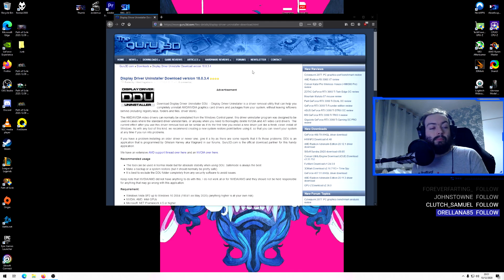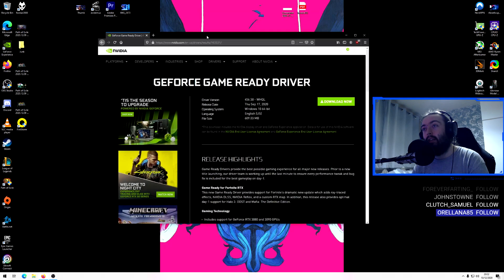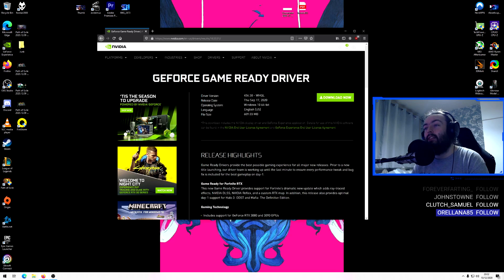Turn on the PC — it'll boot with no LEDs at this point. Windows may throw on some preliminary drivers giving you a big screen at bad resolution. Then go to the website and download Nvidia driver version 456.38 — I'll put the link in the description, you can see it's purple so I've already visited it. This version came out around Thursday the 17th, around when the cards first came out. The fix tool may only work correctly with this particular driver.